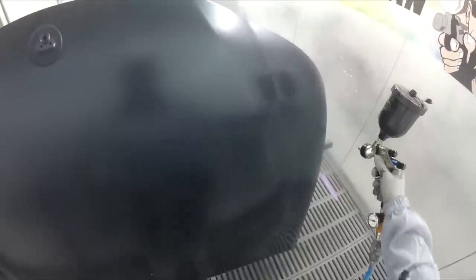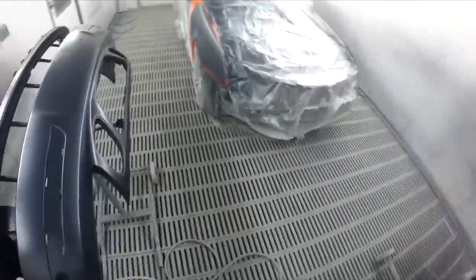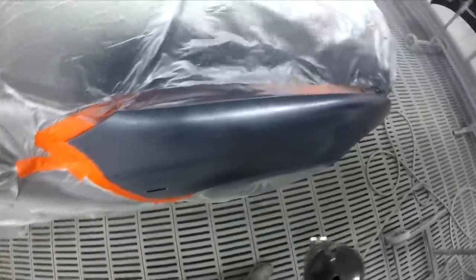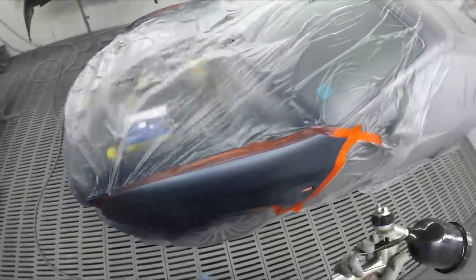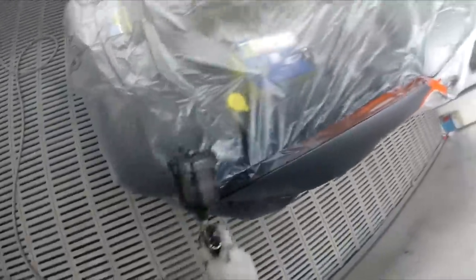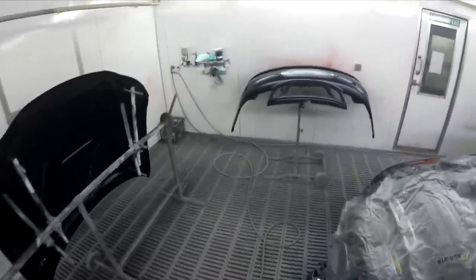It's dark enough to cover. I'll get it to lay evenly, and as you can see that's going down the bottom. I reckon that's covered after two coats — dark colours usually cover a bit better than lighter ones. There are a few nibs I slipped up, just sort of freebies. I'm blending out and going up. It's best to get anything outside of the blend area. There was actually a dent here, but by now that's the blend panel.